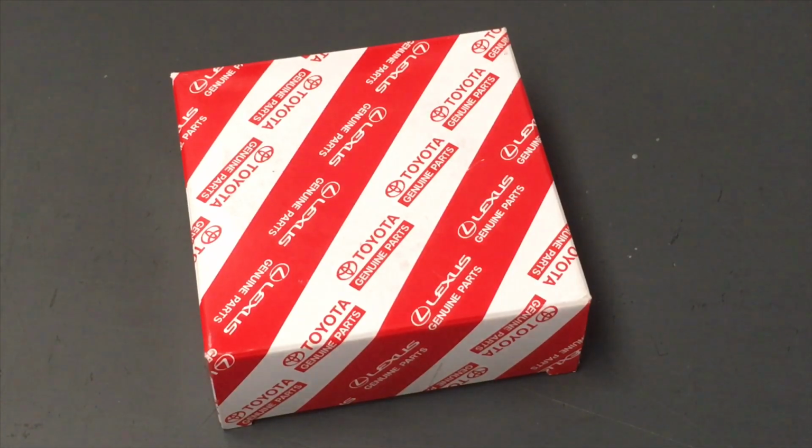We've got a few options there, and what I mean is, even between the Prados and the Hiluxes, they use different bearings, different seals, different O-rings. You'd be surprised how many things are different on something that most of the parts are the same. So what we're going to do, we're going to put together the best options from what we've seen over the years, the best bearing option, the best seal, what we think works right.